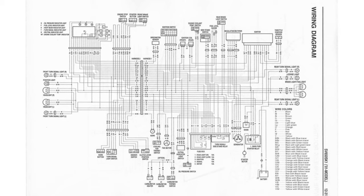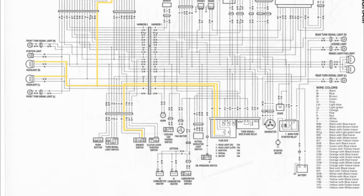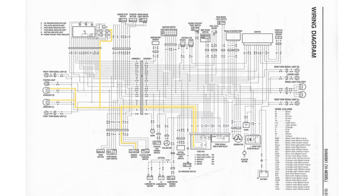If you go from the headlights towards the front of the bike on this, which is on the left hand side, and then you put those into colour, you'll be able to trace where all the wires go. Once you trace your wires from the headlights you'll be able to see what colour is which. If you follow it round, you'll see it goes towards the bottom saying dimmer switch. The dimmer switch on the left hand side says high and low — high for high beam, low for low beam. So you can now see that yellow is in fact for the high beam of the bike. It does take a little bit of looking at and a little bit of tracing cables, but all your colour codes are down here for what colour is what.